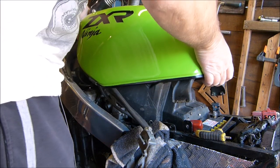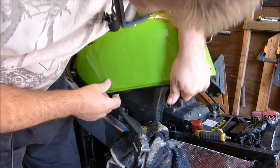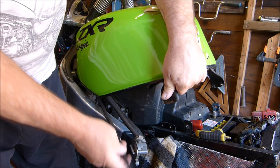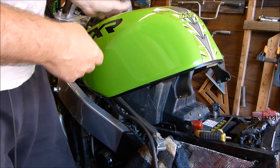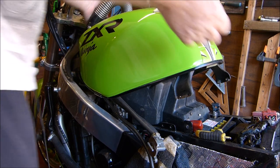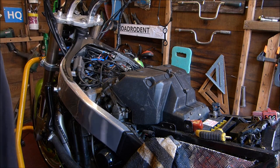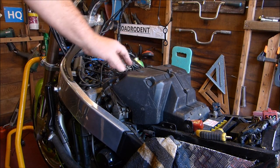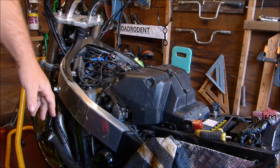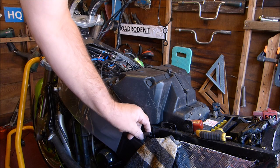There is something else attached — it's been that long since I've taken this fuel tank off. That's just the overflow pipe. You know when you refill it at the filler cap — that's just in case you overfill it and it runs away onto the road. So that should just lift off out of the way. And there we have it — now we have access to the airbox and the carburetors. I'll have to remember about that overflow pipe point when I get this back together, and try to position it so it's not going to get squashed.